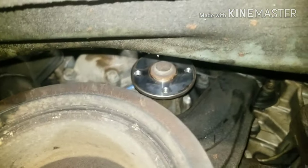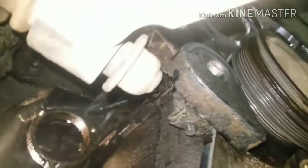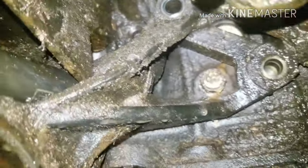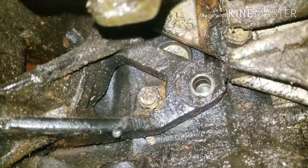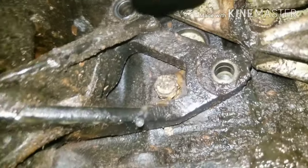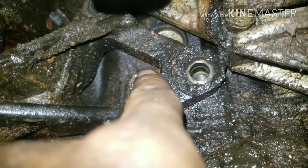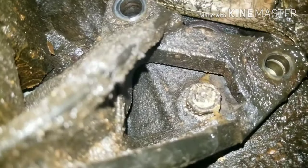But the car's still losing water. Look at that — it's just dripping down on the floor. So the owner requested that the water pump be replaced. However, the issue isn't the water pump. The issue is the freeze plug. Now, you see where that water's dripping there? Go up in there — see that drip? And as you can see, it's running down over that bulb. You see just behind that bracket, there's a freeze plug there. And you can see that green trail that comes down through there — that's the liquid coming down from that freeze plug.